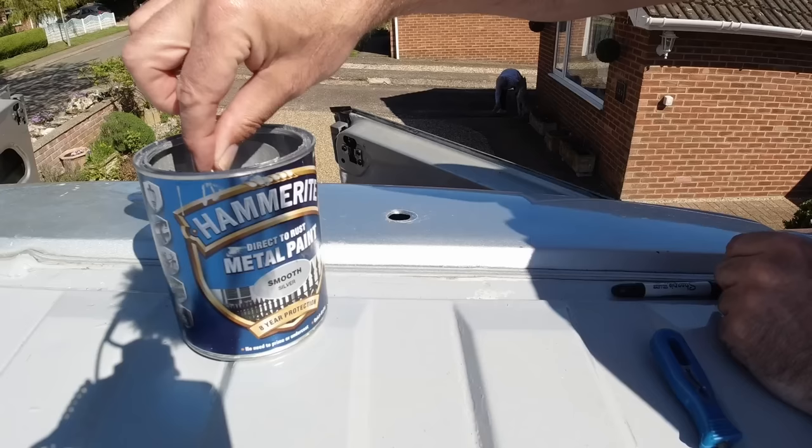The two solar cables come down into this rear box section at the back of the rear doors here. And then I've put some PVC conduit just to give them plenty of protection in there. We've run along to the corner and then we've run down in this rear light pillar in the corner. You can see the conduit running down there. Hopefully you can see that's not too dark. And then that runs all the way down